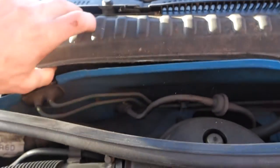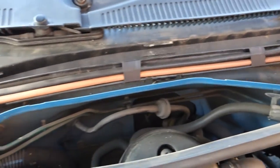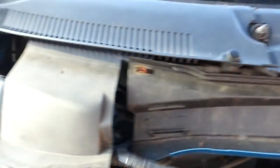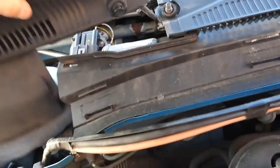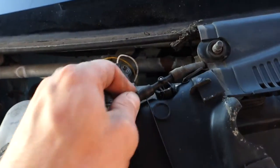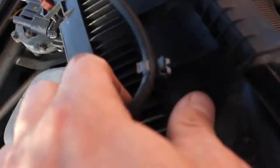You've also got a rubber seal that runs along which you need to pull off to loosen everything. There's a cover here - once you pull the rubber off the edge, pull this cover up and it exposes the battery wires. Get those out of the way before you try to pull the plastic up. You can probably get away with just taking this side off. Pull down and up and it will all pull off. There's a hose on the back clipped in for the washer jets - you can disconnect it or just leave it hanging. Taking it off the clip keeps it out of the way.